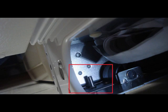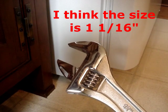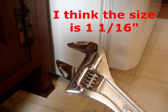There are no flats for a wrench on the top of the leveling foot. To adjust the leveling foot, you'll have to tilt the refrigerator and spin the foot, or you'll need a very flat wrench to fit between the floor and the bottom of the refrigerator when the refrigerator is resting on the roller.